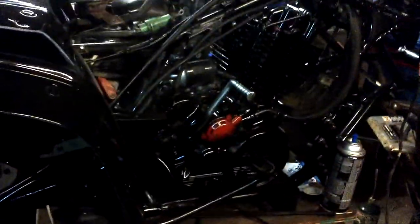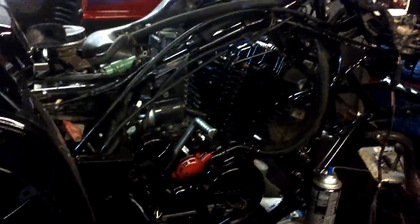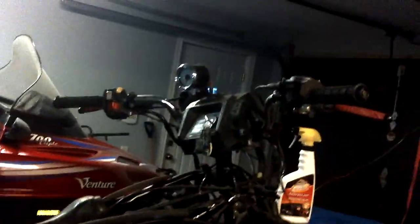Amazing handling. Torque wise, it's always got it in it, and it's always there to start. I've run it at minus, I think it was minus 32 outside, and no ether, nothing. Just give it its full choke, pump the throttle a couple of times, because it's got an auto throw-in thing for gas for the carb, and just start cranking and it'll fire right up, no problems.